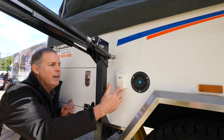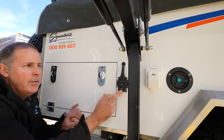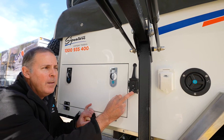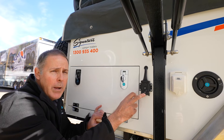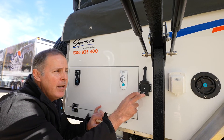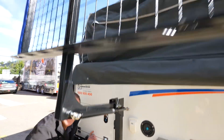And then just a little bit further along, we've got our 50 amp weatherproof Anderson plug just down in here as well. This is dedicated solar input direct to your DC to DC charger that's back inside the camper. Now as I mentioned earlier, this camper has a lithium battery upgrade, so we've fitted an Enerdrive E-Pro battery monitor and shunt to give you much better, accurate readings for your energy into this camper. We'll move down the line a little bit and show you the E-Pro.